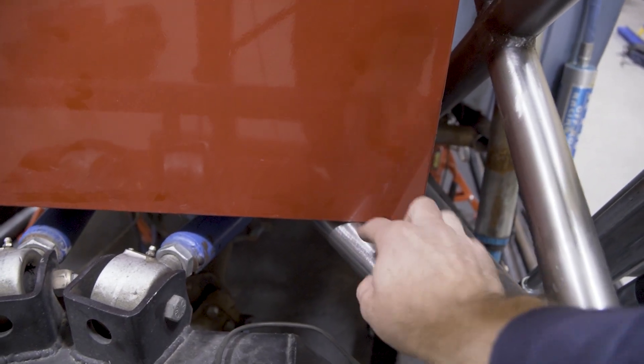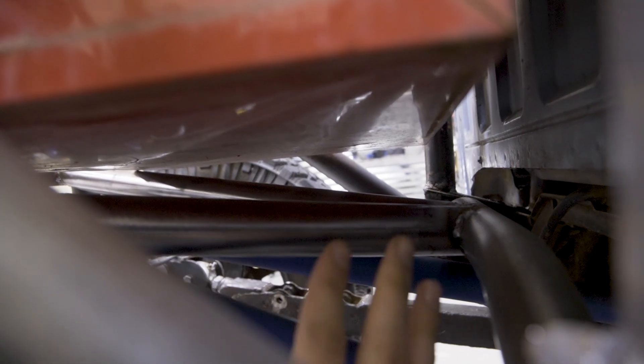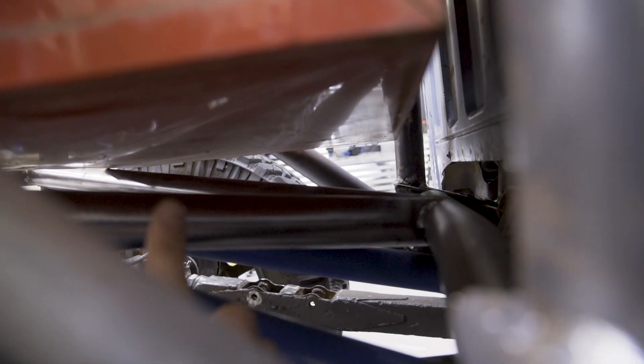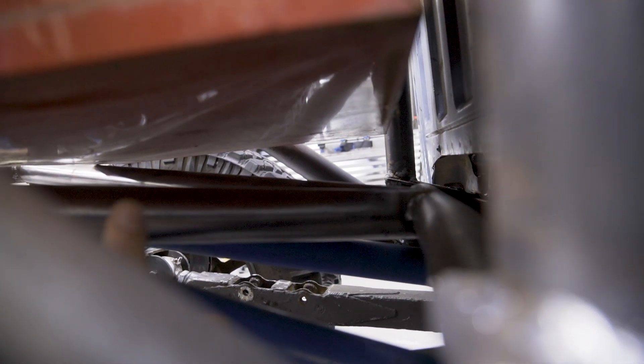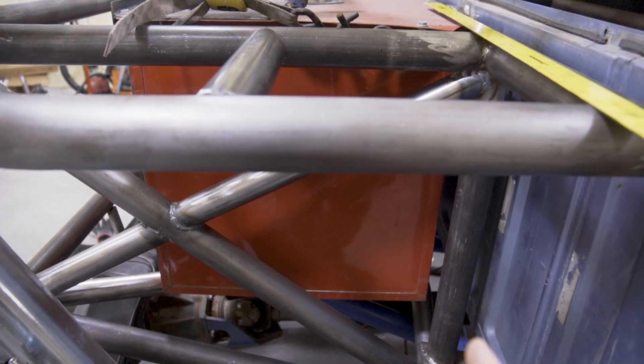My plan to mount this thing — I want to get a corner mount on the back corners and it will notch around this tube. In the front, I'm going to build a corner mount from that to the vertical tube on each side. And then in the very middle, the way I designed the tubes they do slope towards the cab, so I'll do a bridge between those two tubes with a little section in the middle to support the center of the tank. I don't want it to sag over time — this is going to be over a couple hundred pounds of gas when it's completely full.